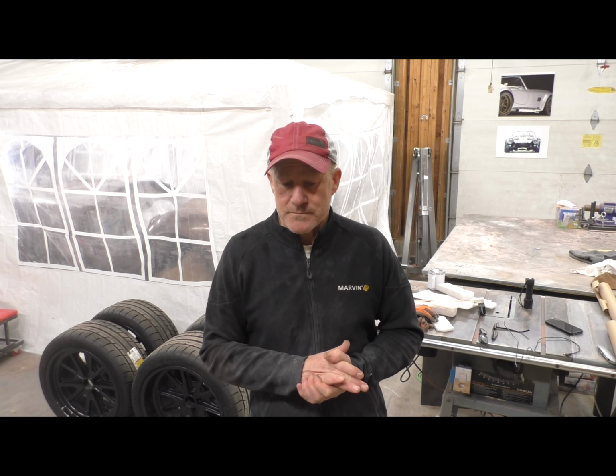I actually almost stopped there because I couldn't imagine the surface being any smoother. But I'm painting a metallic finish, so I was overly sensitive there. I think they always say bring it to at least a 600. So I ended up doing a 600 wet after that 400 wet. I didn't notice any difference in the outcome between the 400 and 600 wet, but in any event, I went to 600 wet.